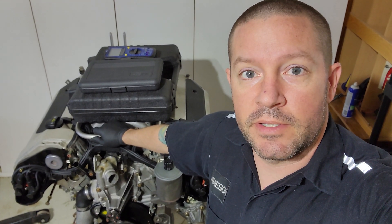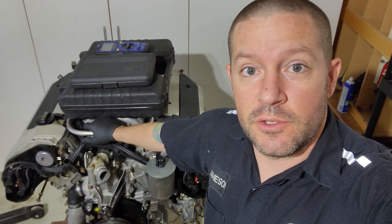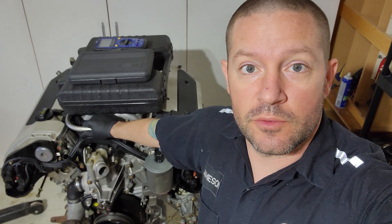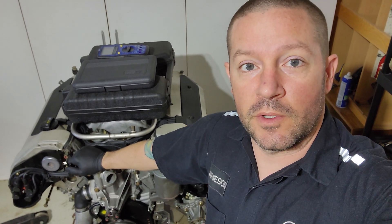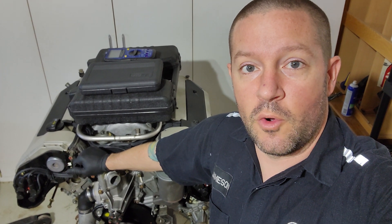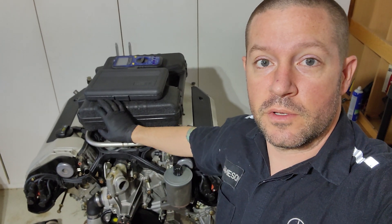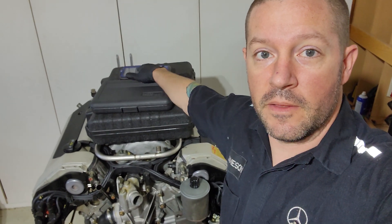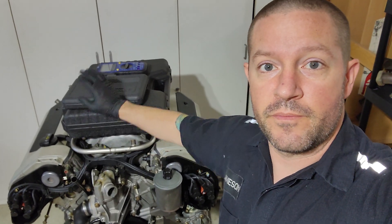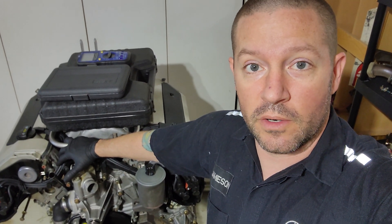Hello and welcome back. I'm your friendly neighborhood technician and on today's video we are going to be attempting to rebuild the lower engine harness. The harness goes from the starter and then up through the bottom to the control modules on the passenger side, right by the bottom of the windshield. Hopefully we can get it all rebuilt and get it functioning properly. We'll go through using the electrical testing set, the meter, and the soldering gun to try to get everything working properly because that lower engine harness is no longer available.